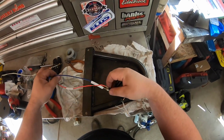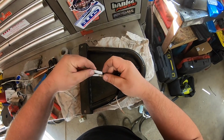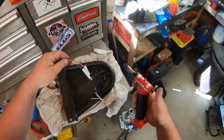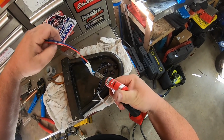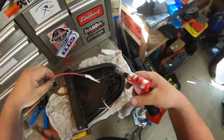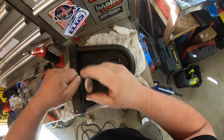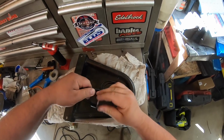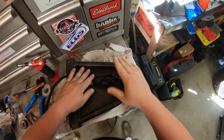So in order to heat shrink this properly, I need to bring 2 pieces of the shrink wrap down now, and then seal them up. Otherwise, when you solder the next leg on, you won't be able to seal those ones. Tape these wires up. That'll help prevent any vibration, so to speak.